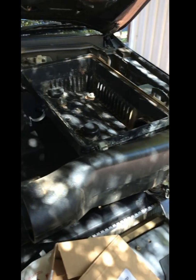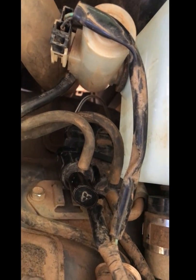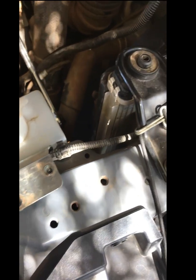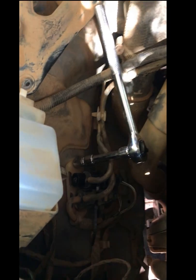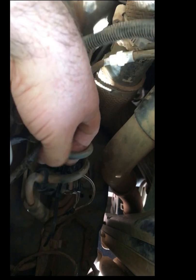I released the screw down there, which let me bring out the bottom of the air filter assembly with the tube intact. Finally, down underneath the water bottle, are the two solenoids — you can just see the top one. I had to remove the aftermarket water bottle for the snorkel, as I couldn't get to one of the bolts on the assembly. With the water bottle off, I can now get to both bolts and remove the solenoid assembly.